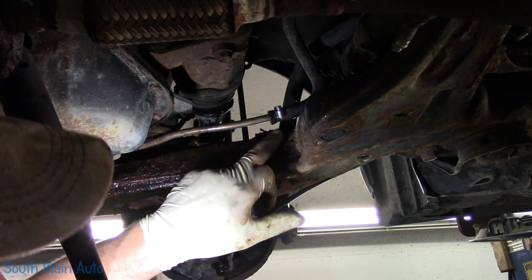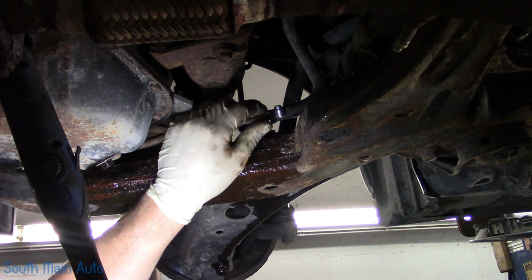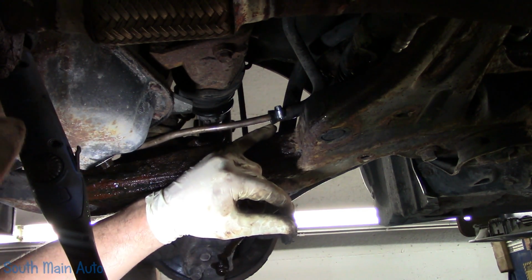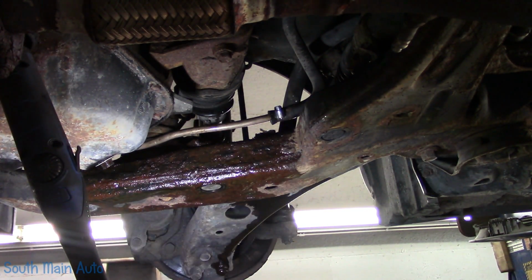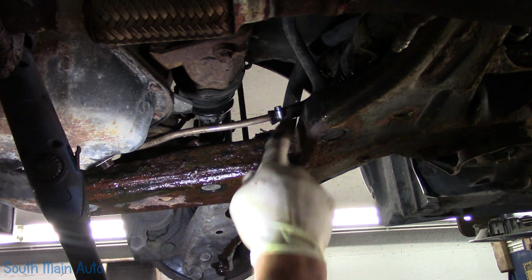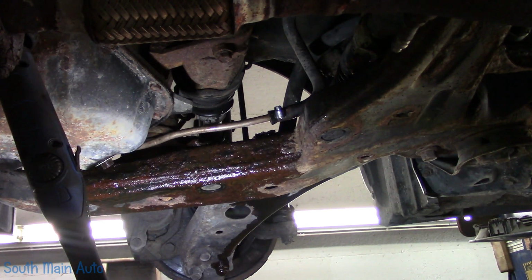So underneath the car, on the opposite end of the line, I just slid the existing rubber hose over and clamped it. Now a lot of people are going to freak out because they see the end of that hose is flared out. The rubber portion of it, that's because the old line was so rusty in there, it just kind of swelled up. I should have just trimmed off the end of the hose, but it really makes no difference. The metal pipe is quite a ways in it. We're past our barb. Now the original clamp was right here, right where that rusty clump is.